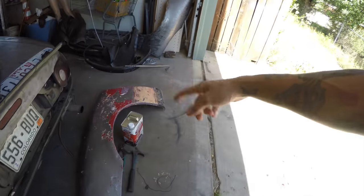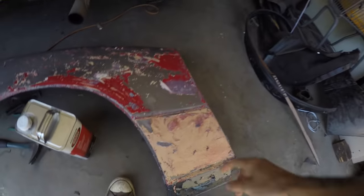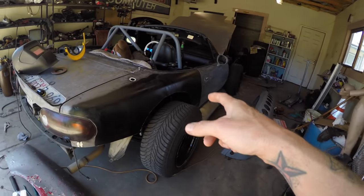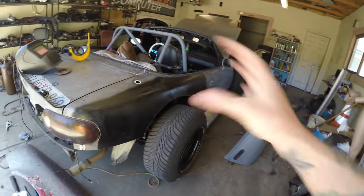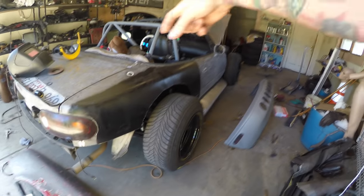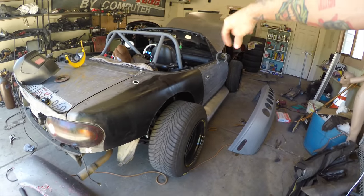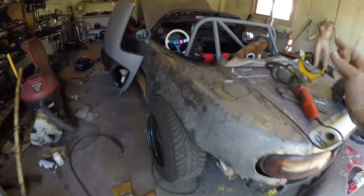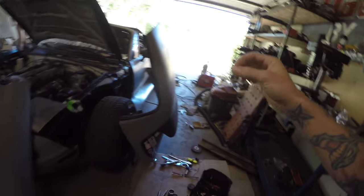I need to wire wheel the rest of this off — looks like some more peeled up. Get the rest wire wheeled off, tack it on to match the other side, get everything tacked together, patch the antenna hole, and then make another strip for the filler between there and the top. Then the rear should be done. I can still roll around without front fenders — it's not like I haven't been doing it already.